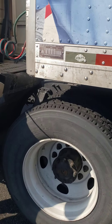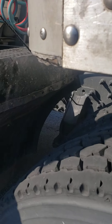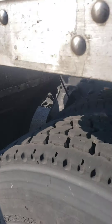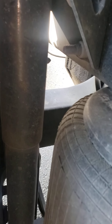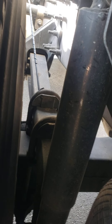On the suspension — my front spring mount is not cracked, securely mounted, and no broken loose or missing parts. My leaf spring — no scissoring, cracks, or illegal welds. My U-bolts are securely mounted with no broken, loose, or missing nuts or bolts, and no broken loose or missing parts.